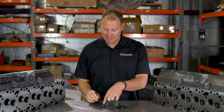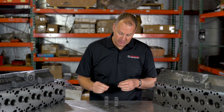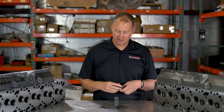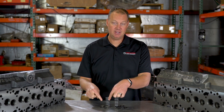The problem, like I said, is these break. What happens is these little tiny locks will actually start to pull through, and it'll just wreck them. So if you're going to do any kind of RPM with this setup, it's a problem. I personally don't like to take a 60-pound spring with stock locks and retainers much over 3,200 RPM. The internet wisdom says 3,800 RPM is safe, and I'm not going to argue with that. But we have had cases — like Will's junker drag truck — where he had this very setup and didn't hardly ever see 3,800 RPM, and he started pulling these through. So for a really long-term reliable setup, I don't like to see this over 3,200 RPM, though you can push it if you like.